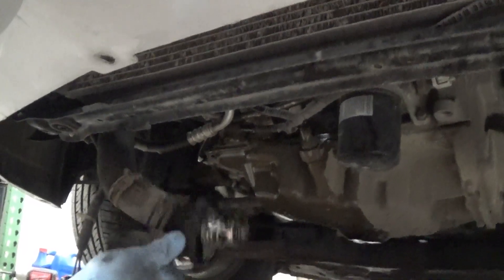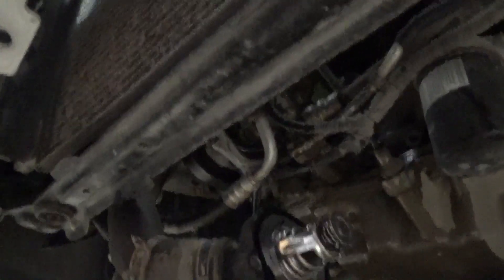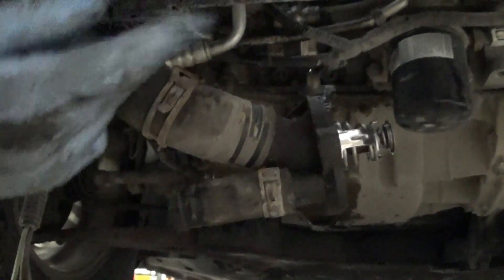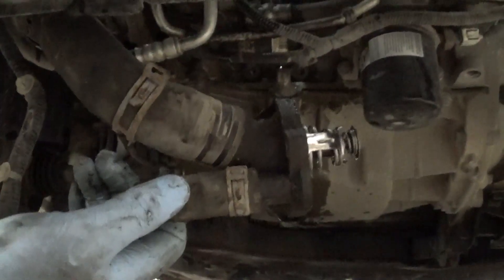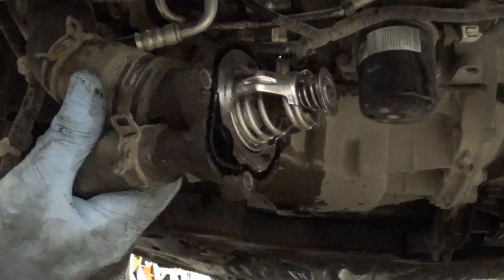Here it is somewhat removed from the car. I doubt this is the correct way to do it, but I took the three bolts out and I just grabbed the lower radiator hose and essentially yanked it out. It was really no fun to get it down here. There are two hoses that come off of it. I took this small one off from the top side and I could not get to this hose clamp — it was up here. I'm going to try and stick the camera down from the top now and show you where this thing lives. Hopefully I can get some more video of it going back in, but it is hard to just try and show what I'm doing here.